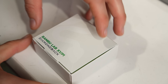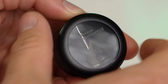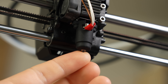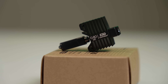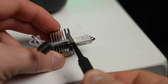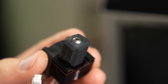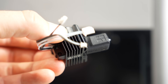Moving on to the toolhead, we're installing the new Diamondback hotend released by E3D. I'm running Diamondbacks on three of my other printers, and while they're pricey, they are very high quality and might be my favorite nozzle type for any heavy abrasive printing. We looked at the E3D High Flow Obsidian upgrade earlier this year, and a common piece of feedback was that it should come fully assembled without requiring harvesting of the heater, thermistor, and fans from another hotend. E3D listened, and this Diamondback hotend is plug and play out of the box.